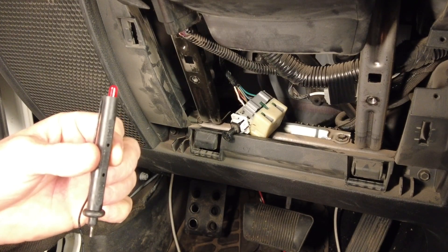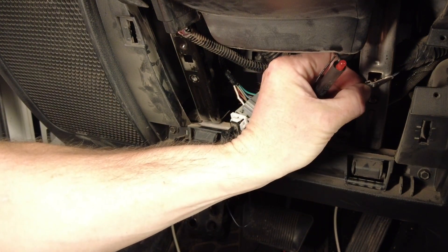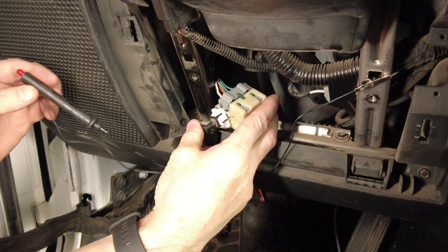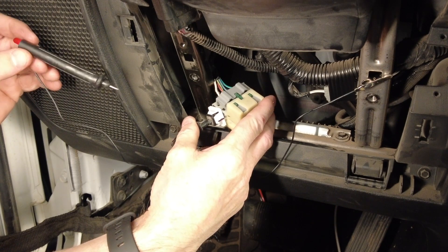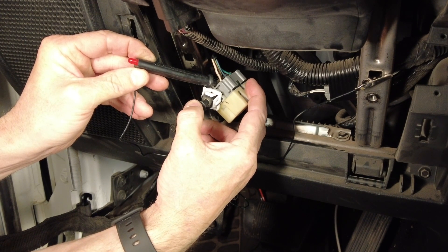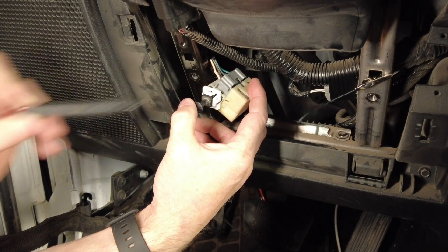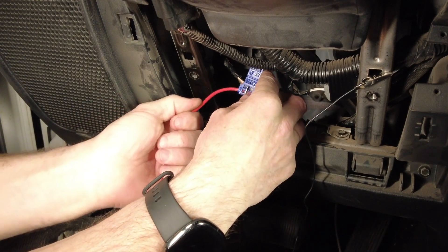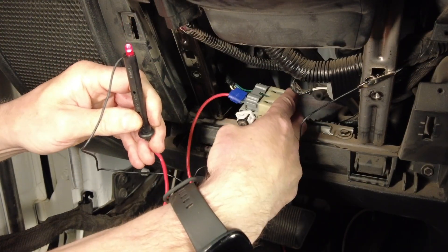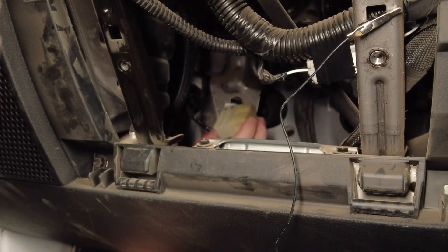The kit comes with a testing light that will light up when it gets voltage. We're going to use this to figure out which wire is the brake switch. First we need to ground it. This plunger is normally in — what we expect is if we push the switch in, the light will go out, and if we release the switch, the light will go on. The light is on at the moment. If I push the plunger in it goes out; if I release it, it comes back on. So we know that this wire — the white and brown wire — is the one we need to connect to. I'm going to use the provided vampire tap to connect that wire to an additional wire we can run to the brake controller. Now we have this red wire and if we test it with our test light it should come on, and if we push the plunger in the light should go out. Now you can twist the brake switch back into place.